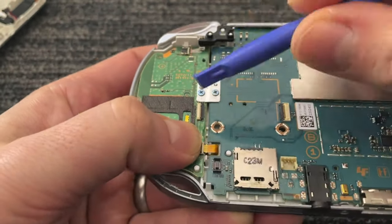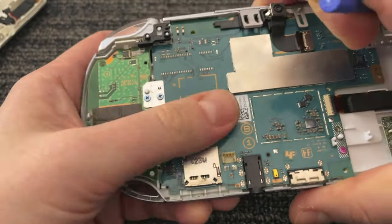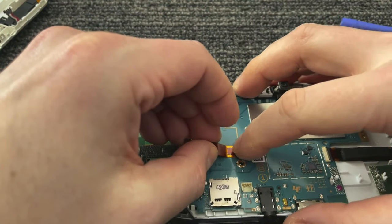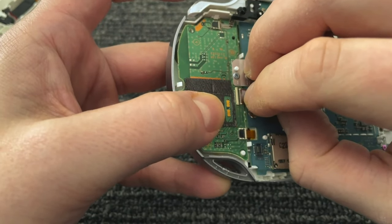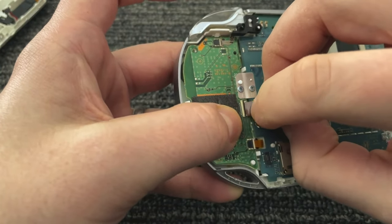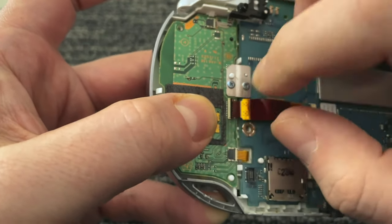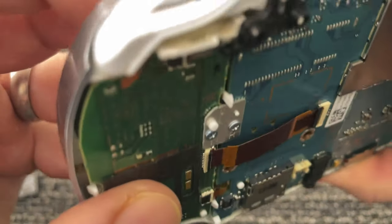This one is probably the hardest one to get in, so you can kind of put your finger on it or a piece of plastic and just push it gently. Then we'll take the new ribbon and slide in the part of the motherboard first that slides right in, and then same process with the other side. It's a little bit of a dance to get it in right, but just be patient. Make sure you're holding the brace up, and then once you have it in just right, you can clip that piece of plastic back down. The ribbon will stick up a little bit like that.